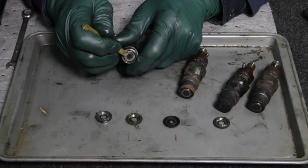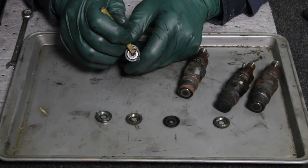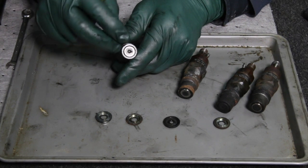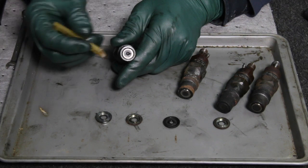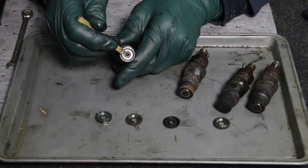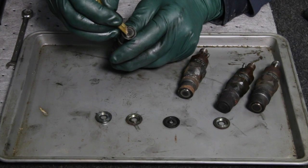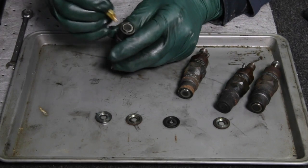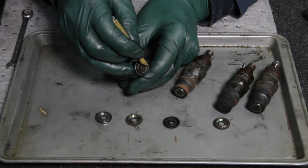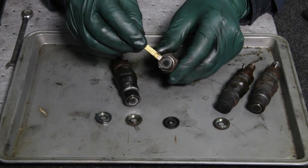So what I'm going to do is scrape the carbon off the tip, being very careful. I can feel the end of the pintle that sticks through that nozzle housing. What I'm looking for is any deformation of the flat surface. What happens is if the injectors start dripping fuel and they don't seal properly, fuel will puddle right around the tip and burn, eventually burning into the metal. You'll see a little concave area right here close to the tip. Look at that — you can see how that's burned away and there's actually scoring in a round circle right close to the tip. That's probably why these look so carboned up and coked — they've probably been dripping fuel.